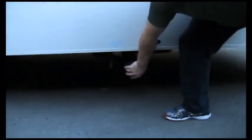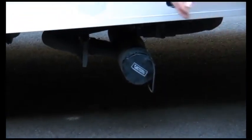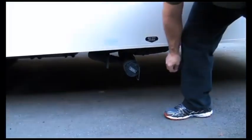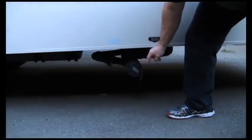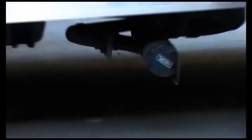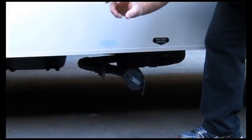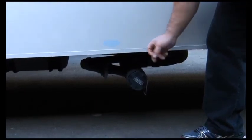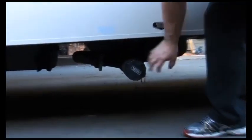Your dump station. You've got a cap that twist-locks on and off. When you take that cap off, don't have your hand underneath because you'll quite often get a few drops of something you don't want on your hand. You've always got at least two valves — a gray tank valve and a black valve. Easy way to tell them apart: the gray tank valve is always narrower than the black tank valve. You've got an inch-and-a-half valve versus three-inch or two-inch. The black valve is always bigger.